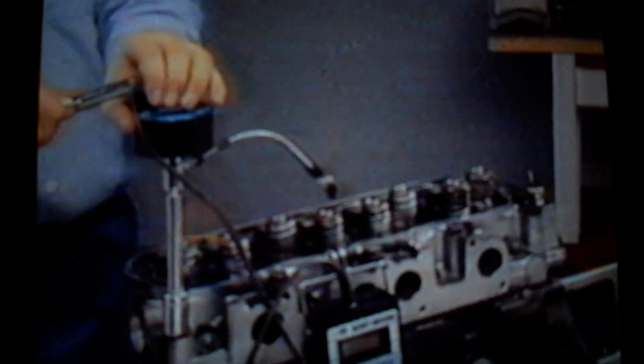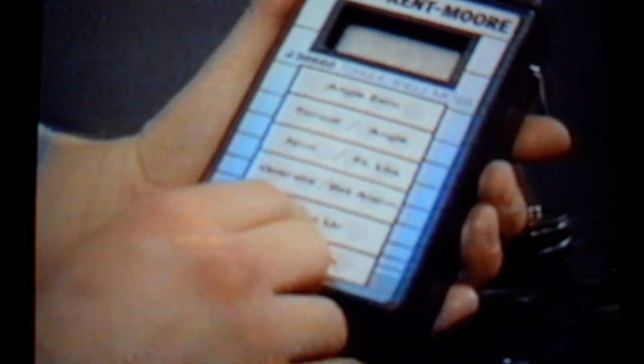The procedure for tightening torque-to-yield bolts has been updated for the 3800 and for the new 3300 engines. The revised procedure incorporates use of the torque angle meter and reduces the possibility of over-tightening the bolts. You'll find the procedure in the 1989 service manual and also in the Know-How reference manual. Granted, using the torque angle meter takes a little longer than just using a torque wrench, but with a little practice, it should become second nature. Consider the possible consequences of not tightening critical fasteners properly. I think you'll agree, the little extra time it takes to use the torque angle method is time well spent.